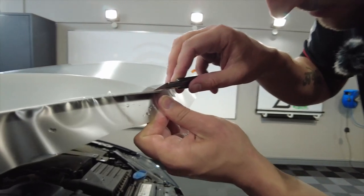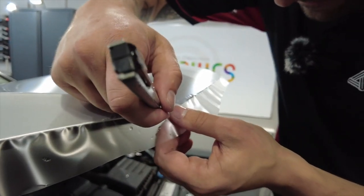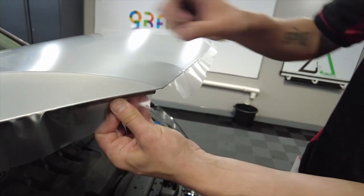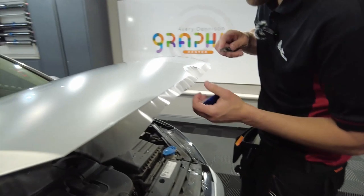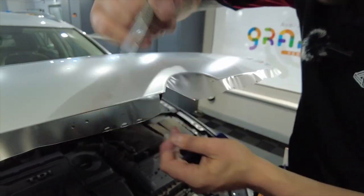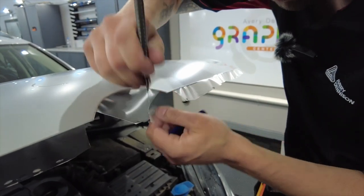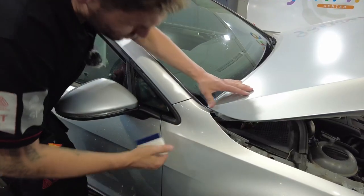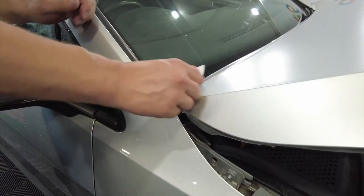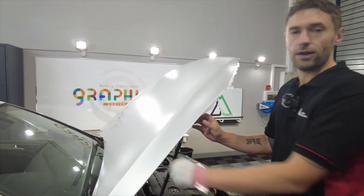Pull the film nice and tight, just a little bit, and then make the flaps. That relieves all the tension off the corner and allows us to fold this film round. We'll do that on every corner. Try not to leave any pointed areas that you can catch when cleaning the vehicle. So now we've come back to it — it's been sitting for a little bit — and we're just going to go round, roll all the edges round and trim this bonnet up.